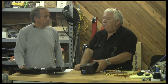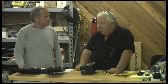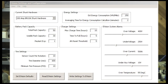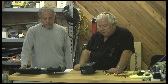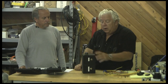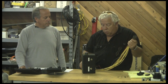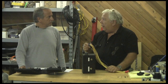He sends you a disk with the system — it's simple software that lets you define things like your pack size. We're going to tell it the pack has 100 amp-hours, so it knows state of charge by counting amp-hours in and out, your tire diameter for speed, and you can define what shows up on the display on each page from a menu of various items. It's a pretty programmable system and we change it quite a bit, so it needs to be accessible. I put it in the box and ran all the other wires to the Amphenol connector — this is the male plug version — and labeled each wire.